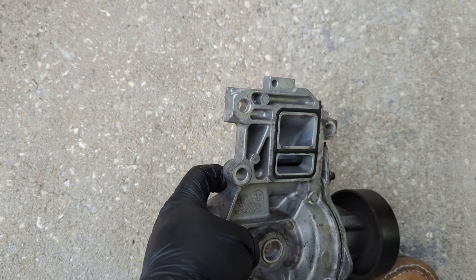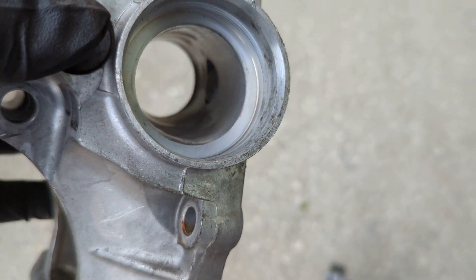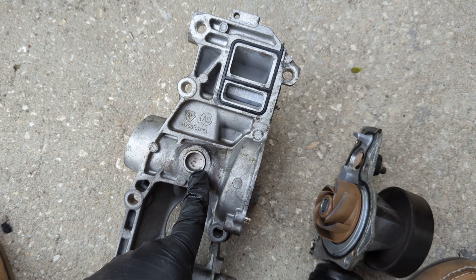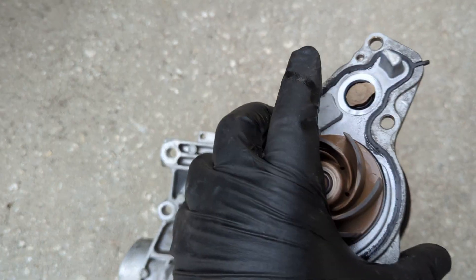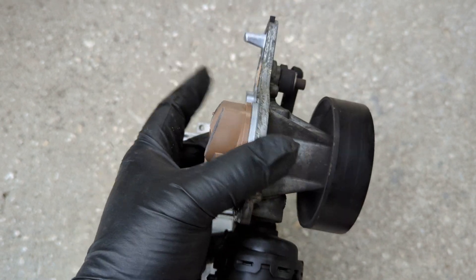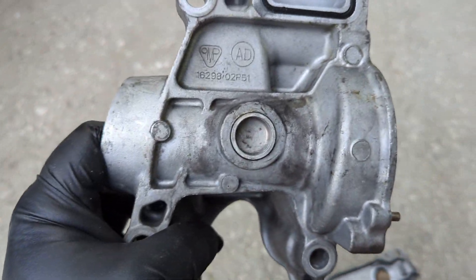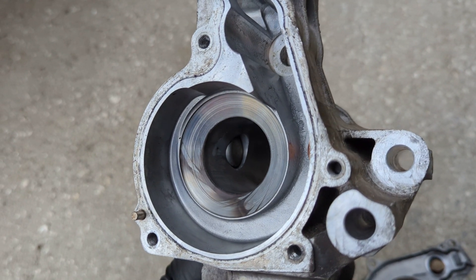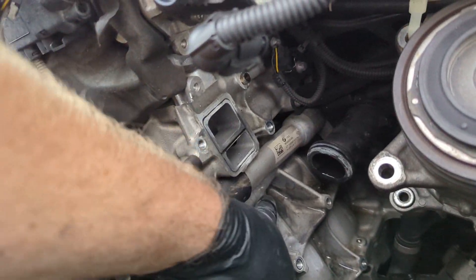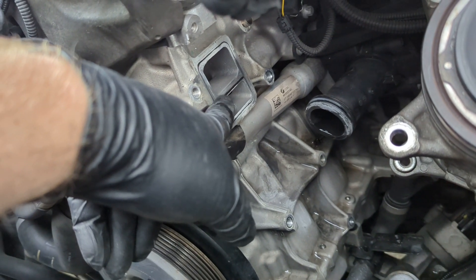I actually ended up putting it back in there. Basically it was obviously from some kind of pressure increase that popped this cap out. I'm not sure if this was broken or if I broke it when I was taking it out — I don't know if that would have caused some kind of pressure increase. Basically I had this giant hole right in the chamber where the water pump sits and it was leaking a tremendous amount of water. It was strange because it would leak down the block — you can actually see where it's wet — and I had a really hard time trying to figure out where it was coming from.